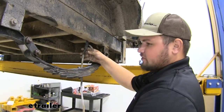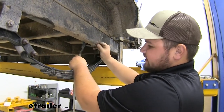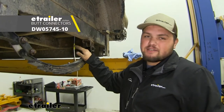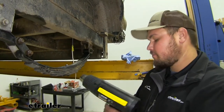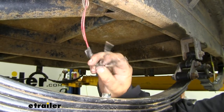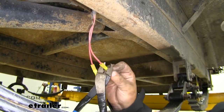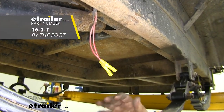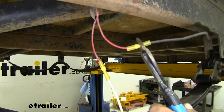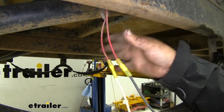Remember we had to cut the wire off our old axle — this pulled the wire out of the old axle tube, so we'll delete this whole wire and make a new connection to our new axle, which has a wire that goes all the way through to the other side. For any wiring we want to make sure we're using heat shrink butt connectors — you can pick those up at eTrailer.com. We also need to clean up our wiring for our front axle. It's important to use a similar gauge wire to what's coming from our trailer, then heat shrink everything down.